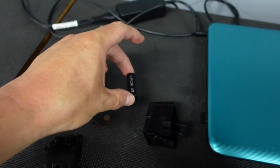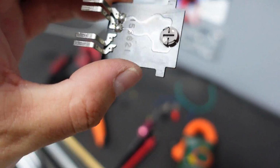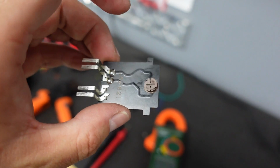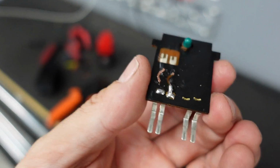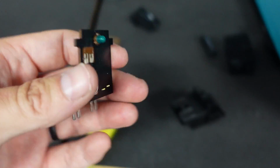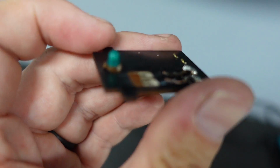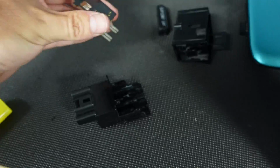It literally is clear plastic behind it there, so it illuminates. But one of the traces went bad. I thought I powered this trace, causing it to burn up, but actually what happened was this trace just failed. I was trying to solder it here, but I didn't realize fitting in here, the board sits so close to everything else, it has to slide on because the button slides so close to it that you actually have to use like a pen almost.